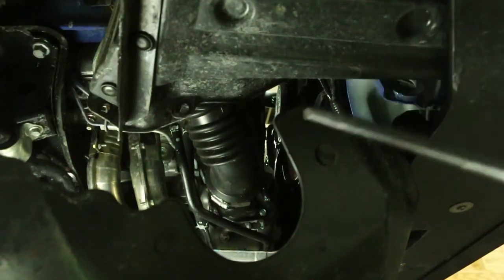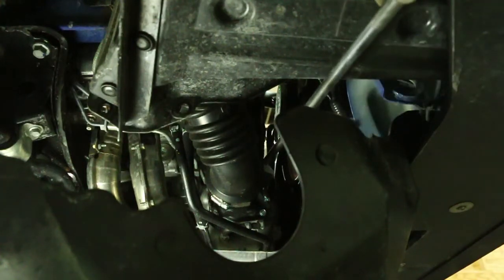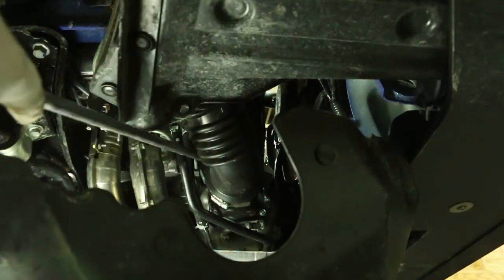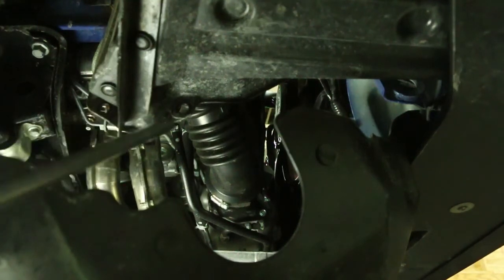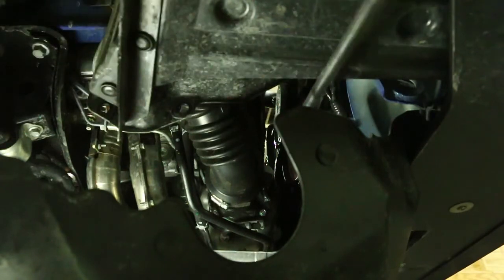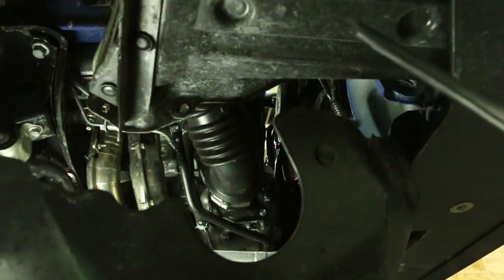So the next thing we're working on is there are two bolts on the turbo. That's on the top side here. You can barely see my extension touching the bolts on the turbo here and here. To access this, you need to drop down the lower tray to access some of the clamps. So you have to take the blow-off valve off, the coupling, and some of the fittings on there too, and then I would suggest a long extension like this from the top to get one of the bolts off the turbo.